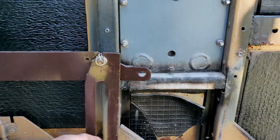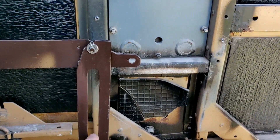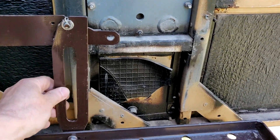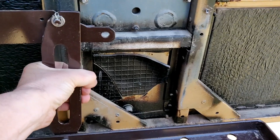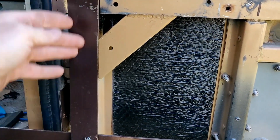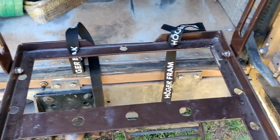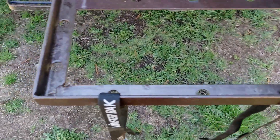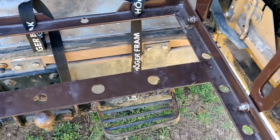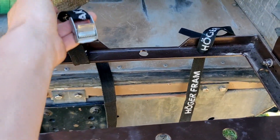On my drop arms, to save a little weight — because fully assembled it was quite heavy — I drilled 20mm holes about 15cm apart and cut out the material in between. There's still plenty of strength since it is 6mm steel. I'm thinking of taking a little out of the arms as well. In my tray, I drilled holes all around it to save weight. It didn't compromise the strength of the tray, and it also gave me a place to run my straps through to hold the fridge in place.